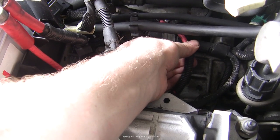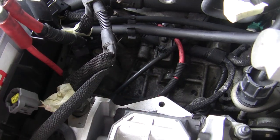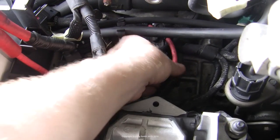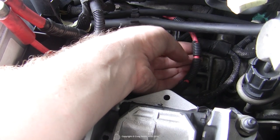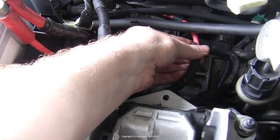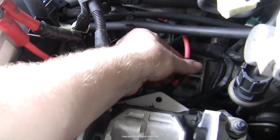Then you need to prepare the existing cabling or wiring for the replacement sleeve, which basically means removing anything remaining. In my case I had bits and pieces of the old stuff which had become brittle and come to pieces, especially next to the engine here above the transmission. So I just had to pick all of that free and remove it.